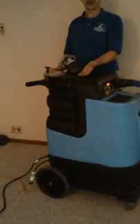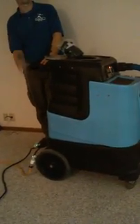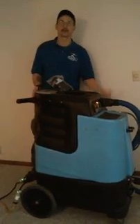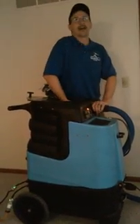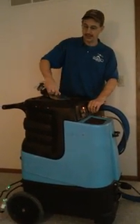Also, when you turn this on, to crank it on, it's going to be very hard to see. There's a shroud that's supposed to be pointing down. So if you crank this too tight, it actually will turn this, and you'll turn that shroud up like this. When you start turning the shroud up, in here there's a little float ball that shuts off the vacuum from sucking any water into the vacuum, and you know that it's full. If you turn it up like that, that ball doesn't come up, and you're shooting it in there, the vacuum is sucking it through, there is an excess on the bottom that will leak the water out. So you'll know that if something starts leaking out of the bottom, 9 times out of 10, it's going to be the shroud is turned up and blowing straight into there. So that's one thing that you want to make sure every time you use it, you check.